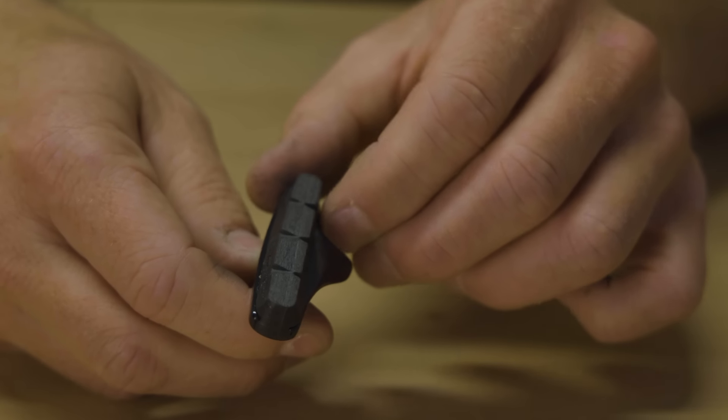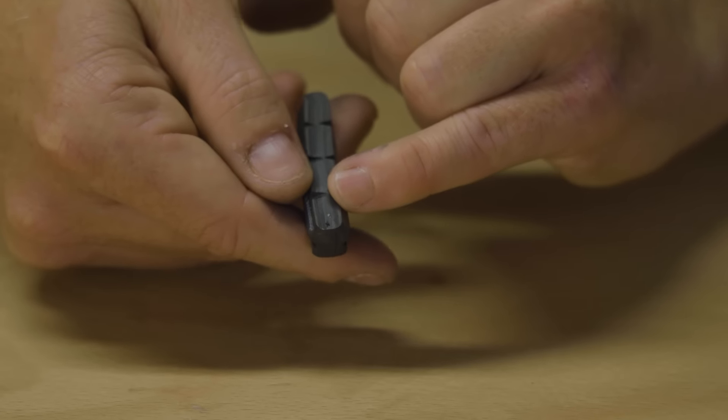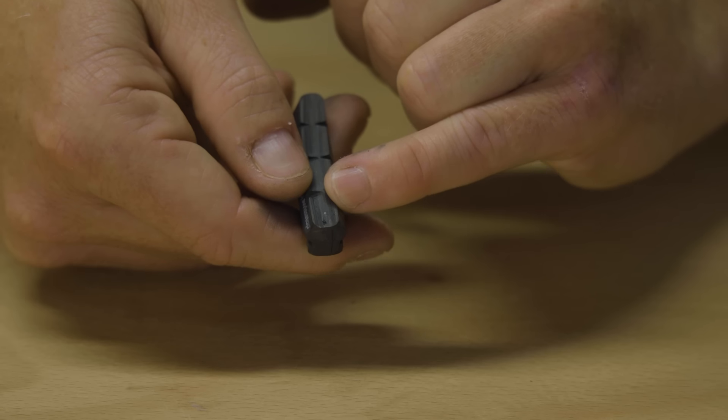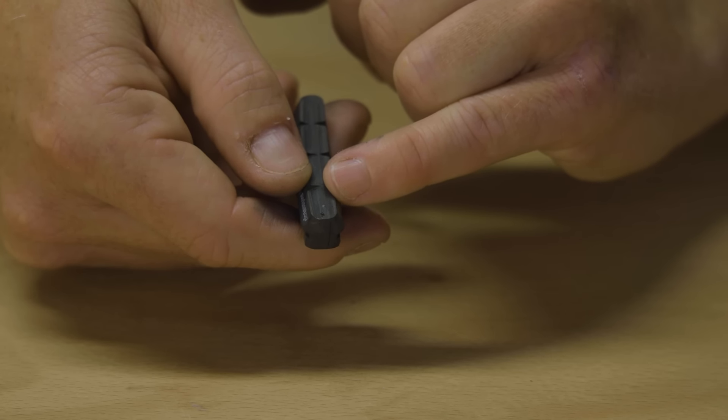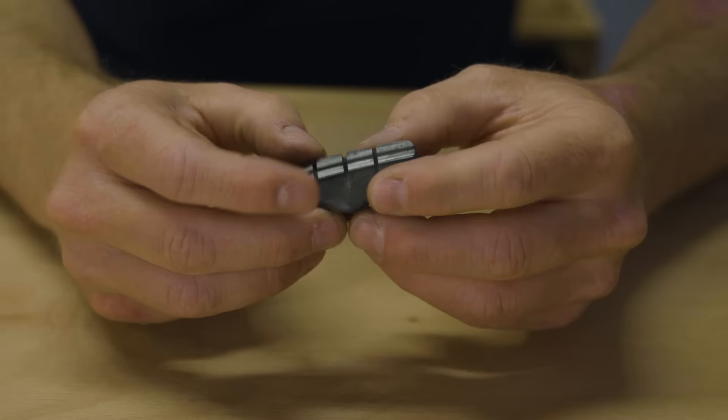You need to select the right brake pads too — it really is important that you get the right pads for the rim material. Some brands suggest that particular pads will work best with their wheels, and there are also different types of pads to suit different conditions. On a basic level, softer compound pads offer greater modulation and are best used during dry summer months, while harder pads are for year-round riding. Softer summer pads won't deteriorate the rim's braking surface as much as they'll deteriorate themselves, but firmer compounds will cause more wear on the braking track over time.